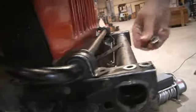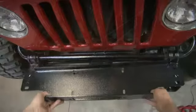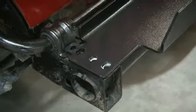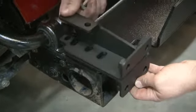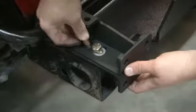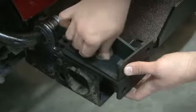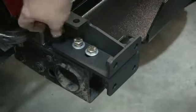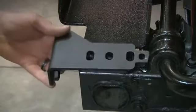The first step in installing our TJ Hybrid stubby bumper is to place these washers on the frame horn. Once those are on the frame horn, you're going to set your winch plate down and try to align these holes as best you can. Now we're going to install the bumper brackets — they go on one on top of the other and you're going to install three bolts that tie into the frame horn. You just want these hand tight for now because we're going to have a step later that shows you how to flush up these mounts.